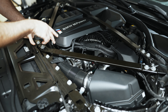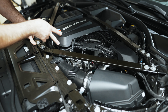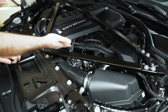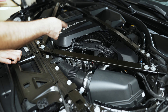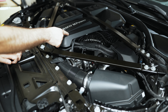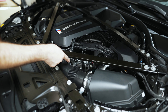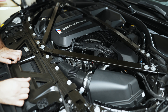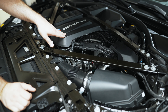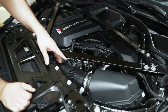On the B58 — I don't have it anymore, I used to have an M340i — they use a traditional mechanical water pump, but they also may not benefit as much from an electronic pump nowadays. On the B58 they have a split cooling system, keeping the engine block at a higher temperature than the head, so you can get a cleaner, more aggressive burn in the block by regulating temperature between the cylinder head and block. You don't really need the pump to do that.